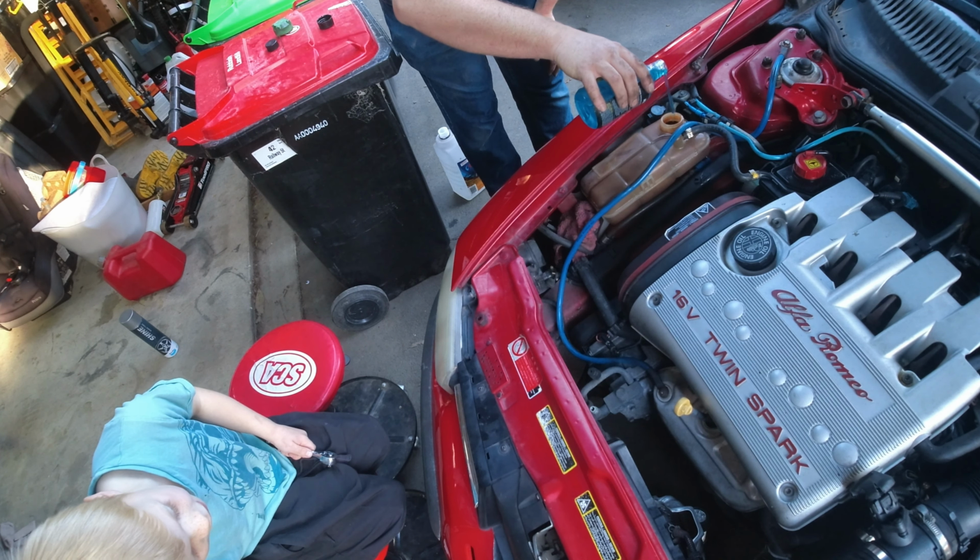Alright, so there's our drops of coolant, and there's our little hoses. Slight concern that there's a little bit of pink up on that bracket up there and over there, so we might be chasing a water pump maybe, but those hoses definitely need changing, so we'll do those and reassess. That's one of those pipes off. It doesn't quite line up, so it's not quite straight, so that's quite annoying, but that's alright. We'll get the other one off and then sort something out.